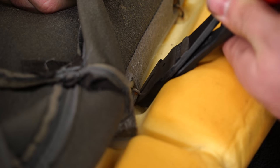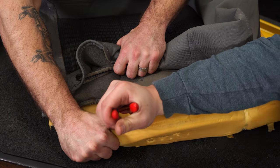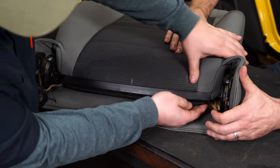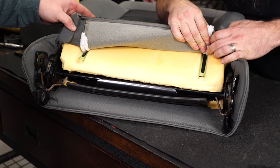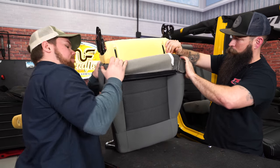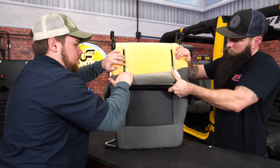There are some hog rings to remove around the sides — grab a pair of snips and just cut them. This is just an upholstery kit, so you are going to want to reuse your original foam — hold on to that. We're going to start working on the seat back. There's a J-clip here that needs to be removed — once you get it started it's pretty easy to pull apart. And unlike the seat bottoms, instead of hog rings we've got Velcro on this one, which makes it a little easier to uninstall.